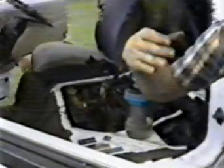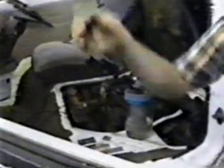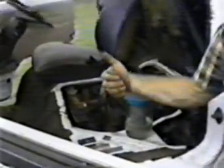You can start it at your 30 degrees advance with your gas off your ignition, and she will start first go. If you go back to one drop of petrol with the gas, she will go rrr, rrr, like the timing is too far advanced. So if you go back to your petrol, she's too far advanced. If you're on the gas, she'll turn over like she's just starting on normal petrol. So it's that critical of alignment. When you mix with your vacuum and everything, you have to get your right gas to your right air, with the hydrogen, oxygen, vacuum. And if you don't get that, it's that critical that she won't go either.